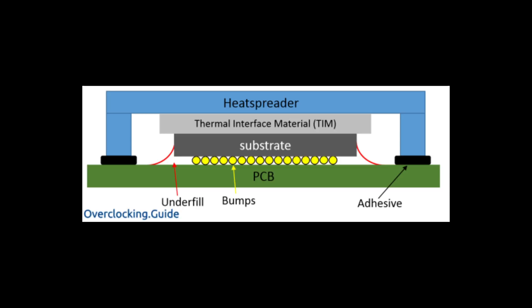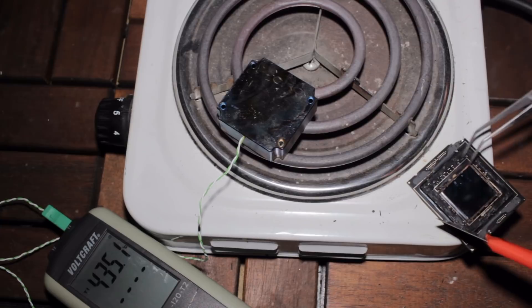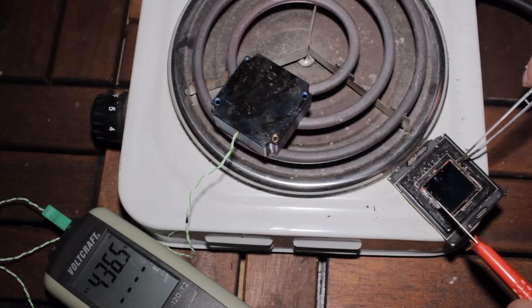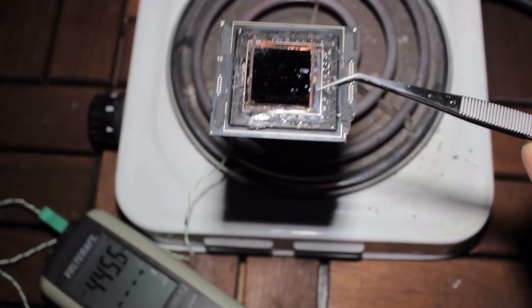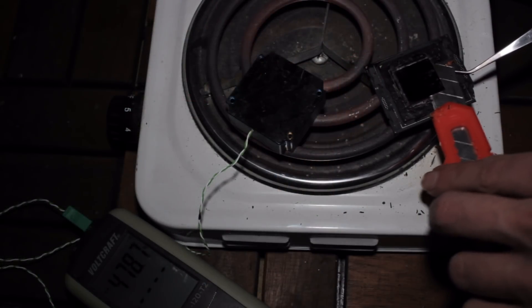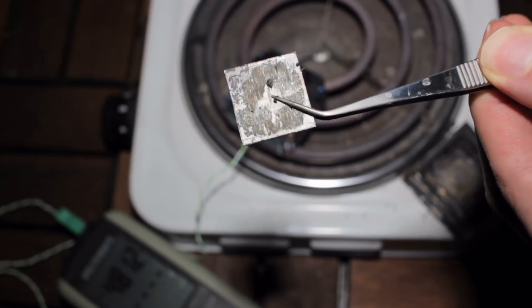What I'm doing is heating up the CPU, then using a knife to scratch off the glue on one side, putting it back on the heating element, and repeating that several times until all the underfill is removed from every side. After removing the underfill from all sides I put the CPU back and heat it to 450–460°C, leaving it for three or four minutes until I can eventually take off the die. I'm always very careful because the die is extremely thin and too much pressure with the knife can crack it. It took about 30 minutes total to take off the 7980XE die, but it eventually worked out.